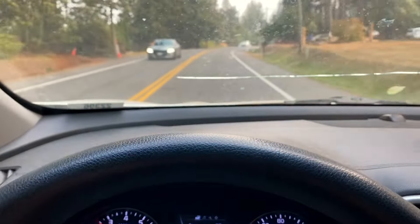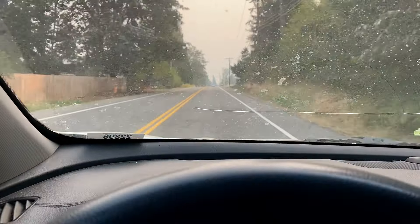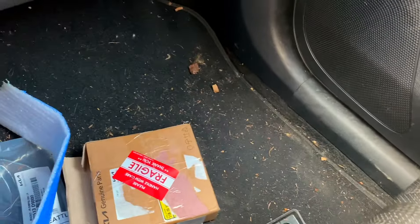Going on a first test drive — the main reason for this drive is to see how off our alignment is. I straighten the car out on a straight stretch of road and yep, we've got a lean to the right side. I would say that in about 99% of the times whenever you have suspension damage, you are going to end up needing an alignment afterwards because things will get thrown off. I don't like farming out stuff like body work, paint, and alignment, so I'm going to knock this out here in a minute and show you guys how I do it. The interior of the car really smells like weed — the car is filthy, there's cannabis all over these cup holders and the floorboards as well.